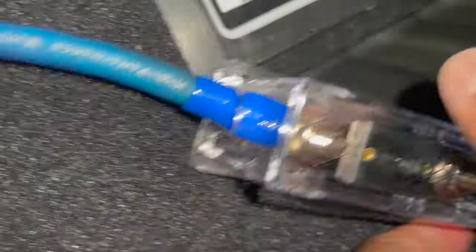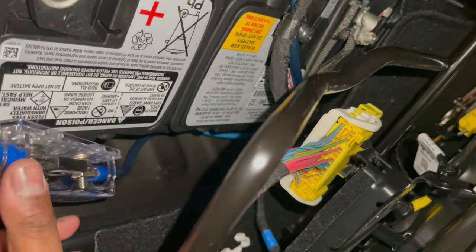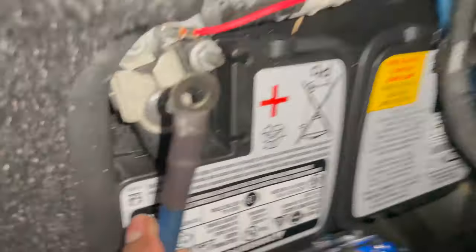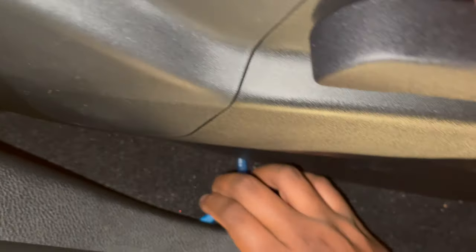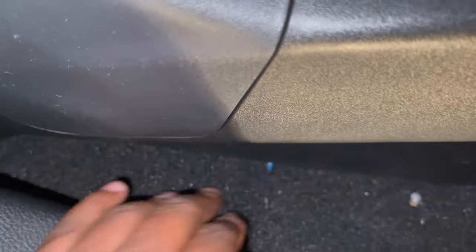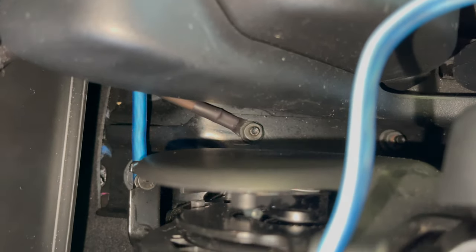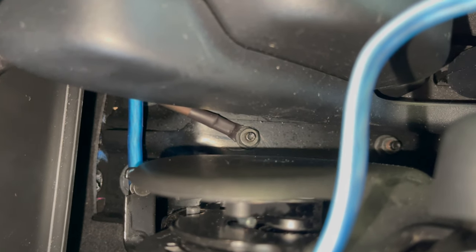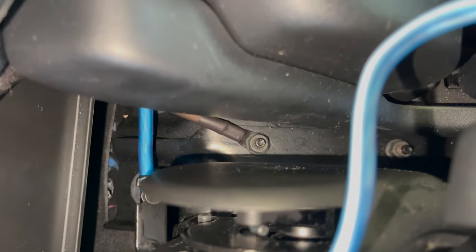There's enough extra room to tuck it down there, and a little extra wire too so you don't have everything all crammed up. I want to connect it — perfect fit. I'm just tucking the wire underneath anything I can get it under so it doesn't show too much. For the ground wire, I chose one of the bolts in between the two seats. Just pull up the bolt with a 13-millimeter ratchet, scrape up the paint, put down your ground wire, and connect it — you'll be fine.